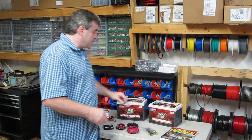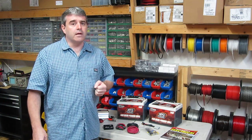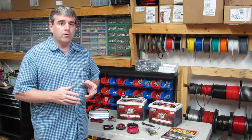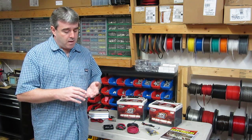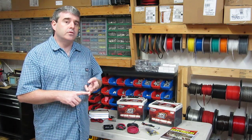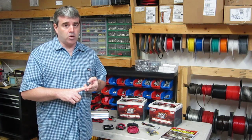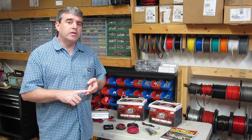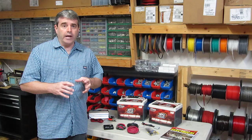So that's substantially more output voltage, which leads us to our next challenge. With the vehicle running, we're going to now have in excess of 2 volts greater operating voltage for all of our electronic accessories. Things like electric fans, electric water pumps, electric fuel pumps — when we increase the operating voltage to those devices, we're also going to increase the amount of current that flows to them. So when we increase voltage and current, that device is going to respond by doing more work.